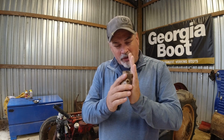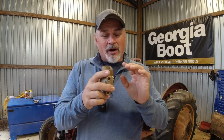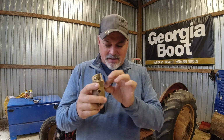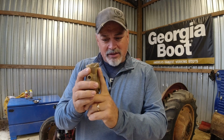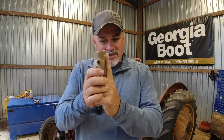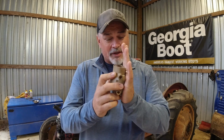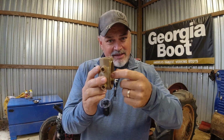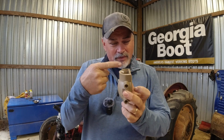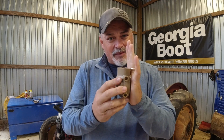When I put the distributor onto the motor, the slot behind the distributor was not keyed properly, right? And so my rotor button was not turning. It was just stationary. So I took the distributor off, and you've seen that already. And I said, oh, look, I need to put it in the keyed slot. So I put the key slot in there, and the rotor button started turning. But what happened was that behind the distributor, that keyed slot was making the rotor button protrude. Well, that's why the distributor cap did not sit flush on the distributor, because that keyed slot was keeping that rotor button protruding. So when I aligned the key to the slot in the motor, that allowed it to go closer to the engine block, I guess you would say, which would have allowed this nipple to make contact with it and set flush on the distributor cap.